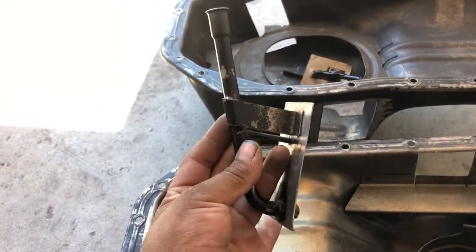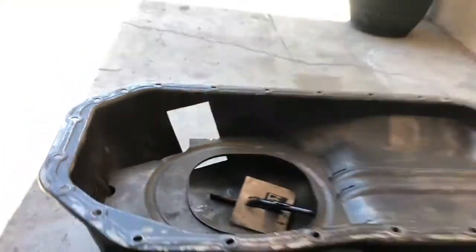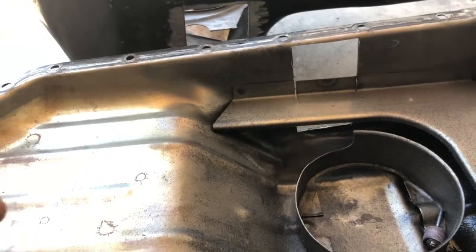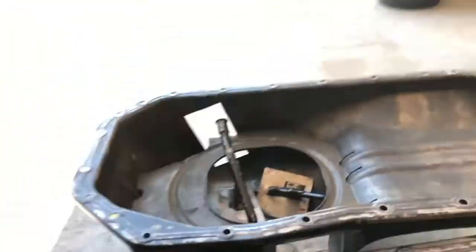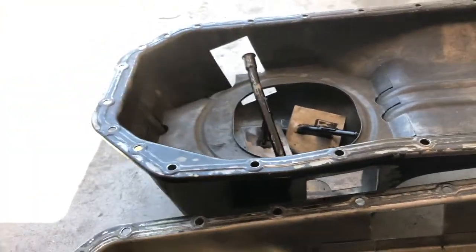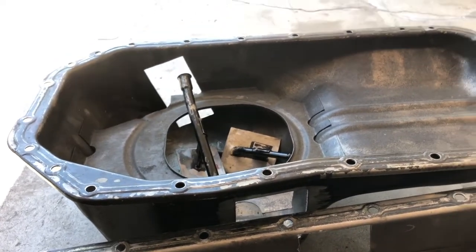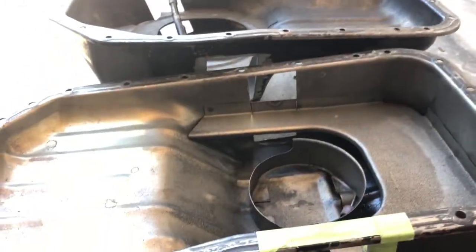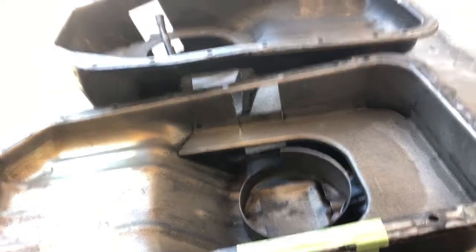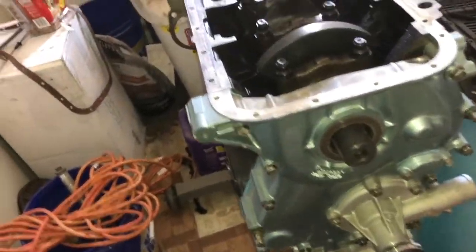You need to swap out the oil pans and get these welded on - this fitting is for the dipstick. I'm not doing it exactly like the original would have been, but because it's such a larger oil pan it won't really matter too much when it shows low on the dipstick. I'll still have extra oil so I'll just add some to make sure I never run low.